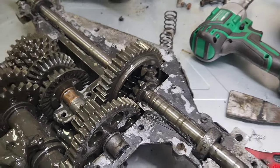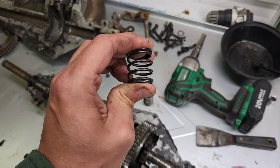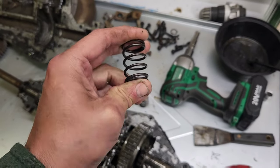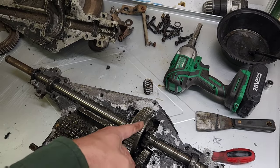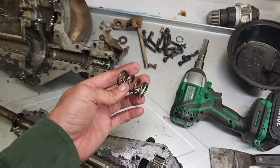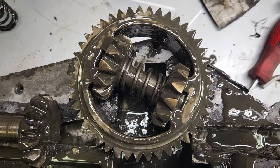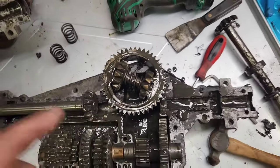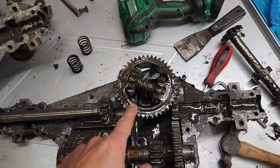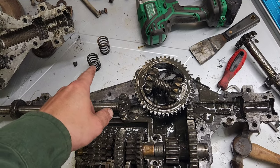There's our upgrade spring and the spring that's been in there during testing — it seemed to work out pretty good. These are progressive springs, meaning the shorter it gets the harder it is to push. I probably could have shimmed it out with washers and tacked them in, but a set of two of these was only about $10. The bigger, better spring is in there now — it's pretty darn tight. It'll still turn if you really torque on it but it's significantly tighter than the stock Briggs and Stratton Intek spring.